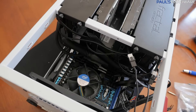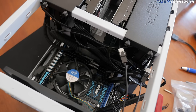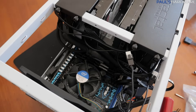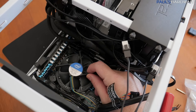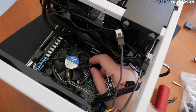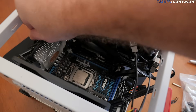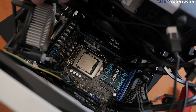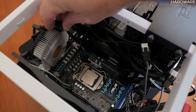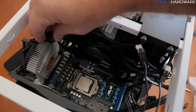One last important thing — if you're working with older hardware you've had around for a while, don't always assume everything is the way it should be. I had the stock heatsink fan on this board, and I used this board in my HTPC for quite a while before building a new one about a year ago. I decided to pull the heatsink off to double-check, and thank God I did — there was absolutely no thermal paste on it. I'm going to add some thermal paste, pop it back on, and then get the software running.